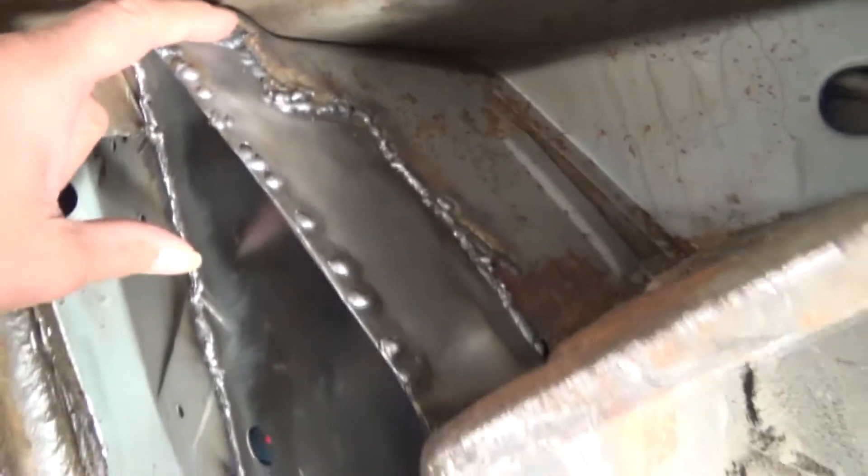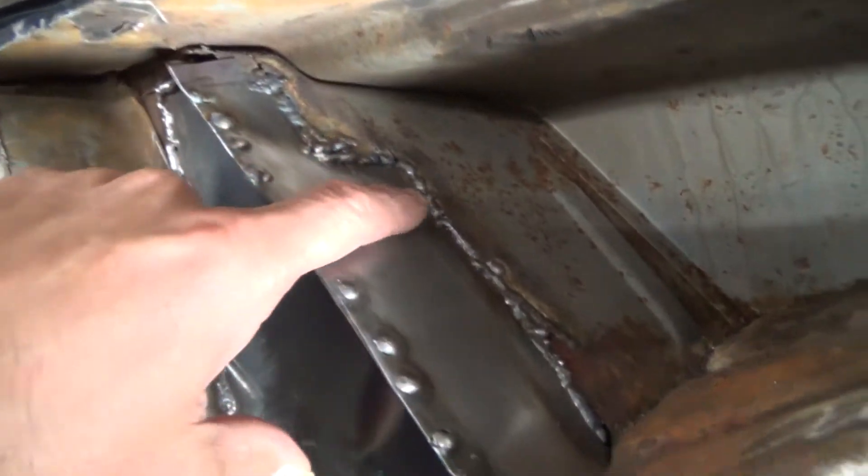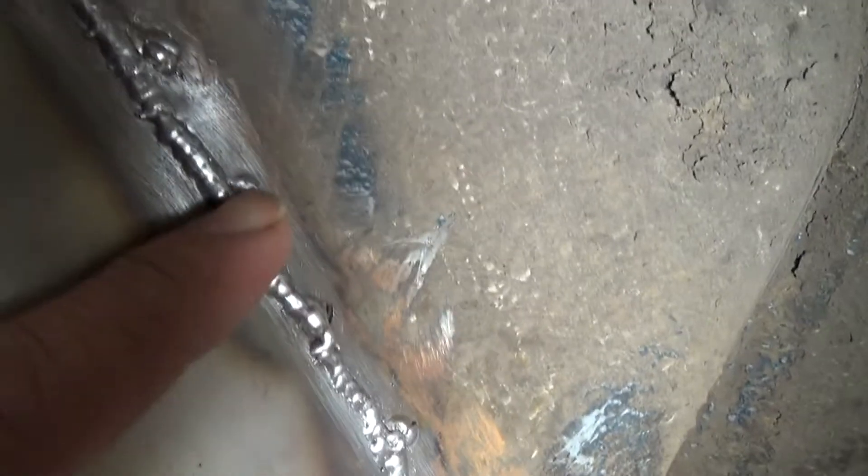The panel's welded in now, I think I'm happy with that at this stage. The inner lip I've seam welded in — you can see that, that's where I did the step. Just showing a quick close-up of my welds. I try to keep the welds as small as possible because I'm going to grind these flat with a flap wheel to get this all nice and flat.